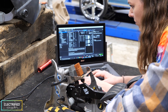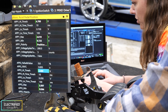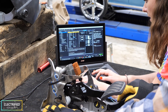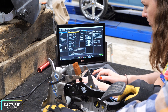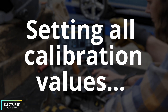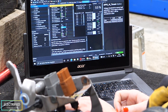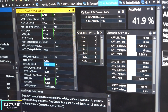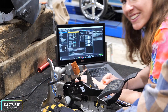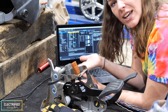We can set the minimum and maximum voltage that the pedal position corresponds to for each sensor. Now we need to set the high limit — go full throttle! Okay, that's 4.6 volts for the first sensor. So now what we see is 0% is closed and 100% is full throttle. This is how you calibrate your acceleration pedal for an electric conversion with AEM.